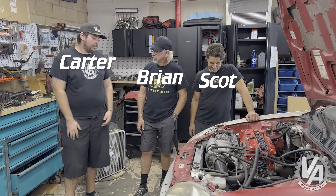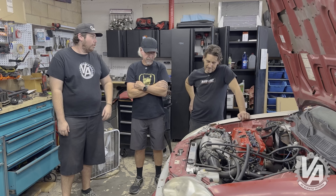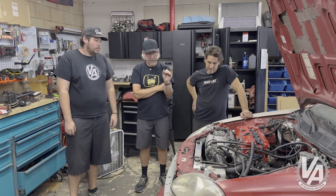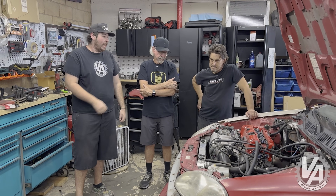Although this will be a track car, I love cruising on the street. The weather's finally nice in Arizona, so I wanted to take it out and drive it. Power steering seemed like a really nice creature comfort that even in a track day car would be awesome to have. But this was kind of interesting — on this particular power steering setup, it was actually more difficult than any of the others we've taken the power steering out of. Compared to like my DA or the Budgie EG when they had power racks that were depowered, this one felt like it would almost start to bind or get squishy the farther you try to turn it, and it would spring itself back when you let the steering wheel go.